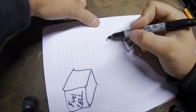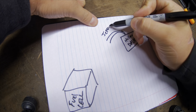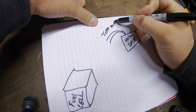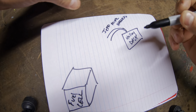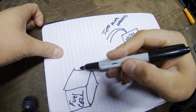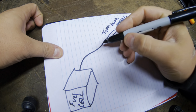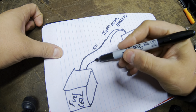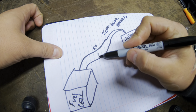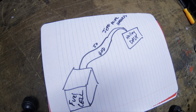For my particular setup I'm going to be using IO channel 10, which I will show you when I go to the actual dashboard. You have two wires from your fuel cell for your resistance — one goes to your input channel (channel 10 for mine) and the other wire goes to the ground wire that's also on the dash harness. This ground wire is shared between all your other sensor grounds. You can also use different IO channels; just make sure before you do that it can read resistance.